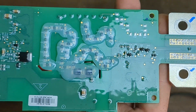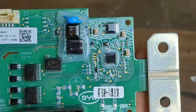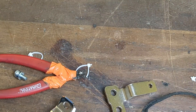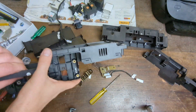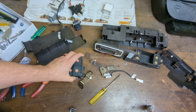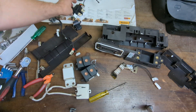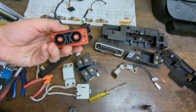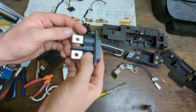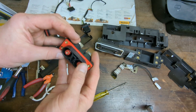It's not bad design — they've crammed a lot of stuff in where they could across the front of the battery pack. Why the contactors are different I'll never know. The fuse is quite good — it's quite small for the size that it is. The pre-charge resistor is what it is. The connector is quite small and low profile with no sort of interlock on it at all, so you could unplug this and theoretically, if the contactor is still powered up, it wouldn't have any idea that you've unplugged it. Not sure how I feel about that.